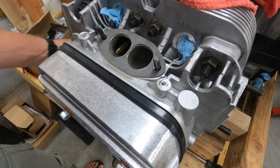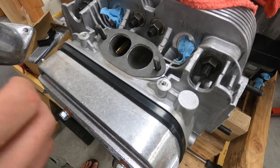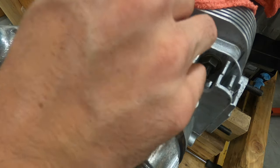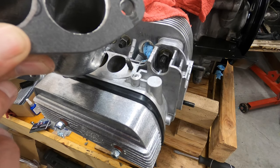Make sure you've got your intake manifold marked somehow — I've got a left and a right marking right there. We're gonna take it and put it on the bottom. You don't want to take too much material off, but you want to match them to where the studs are going to be.